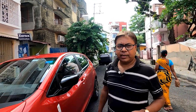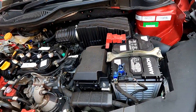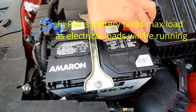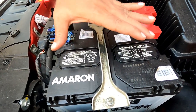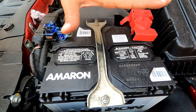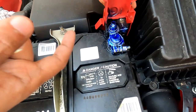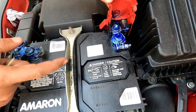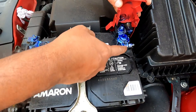You should definitely invest in good tyres if yours are inadequate this rainy season. Open the engine compartment and check the battery — if you have a multimeter you can check it yourself, and do check all the battery electrolytes. If you can't, go to a battery shop and ask them to check the battery health condition. You need a very strong battery during monsoon season. Due to moisture, there will be sulphur deposits on the terminals, so clean the terminals and apply battery terminal paint so it won't attract sulphur and will remain corrosion-free.